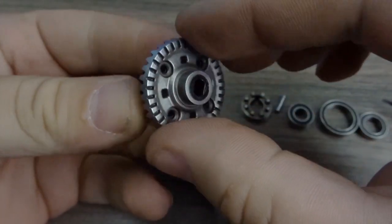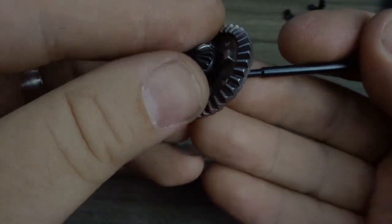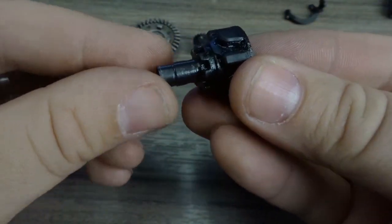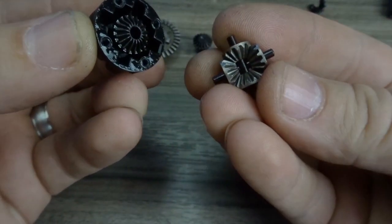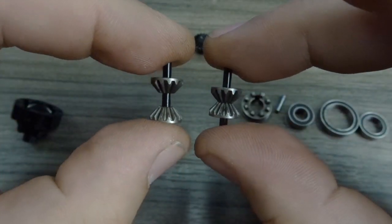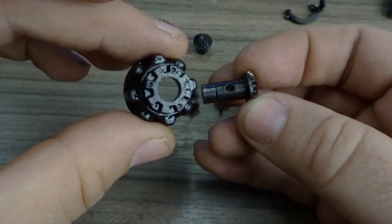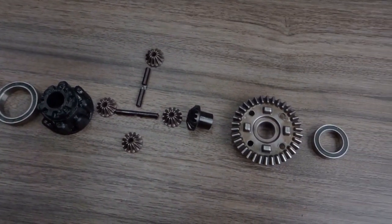Once you've got those four screws removed you can separate the ring gear from the diff cup and that will give you access to the differential gear spiders. The drive gear on the outside can be removed separately — that's a heavier duty hardened steel gear compared to the center ring gear. You can push on one side of the output of the differential to help remove the four spider gears and two cross pins from the differential cup. These are made up of two different shafts with flat spots that lie onto each other to get all aligned. Here you can see the diff cup with the engagement for the locking differential, and here is that assembly all laid out to give you an idea of all the parts.